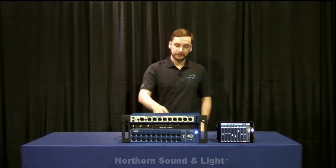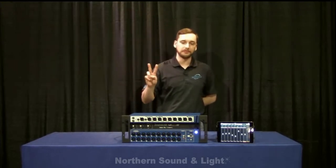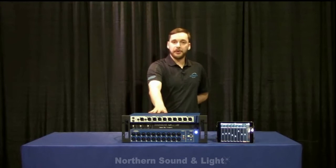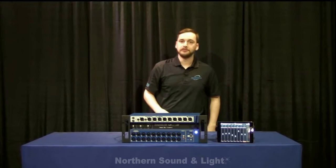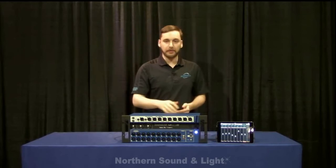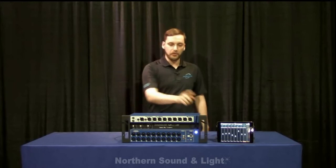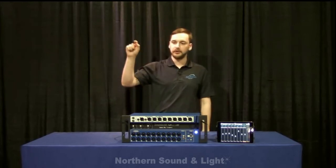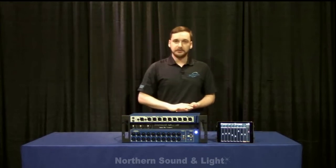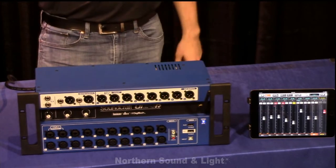There are three different ways you can record. The simplest is to plug a USB stick in the front and record your two-track master output — just hit record and it captures everything going out through your left and right. You can also connect it to your computer, at which point it's a 32-in, 32-out interface — use it with Logic, Reaper, Pro Tools, Cubase, whatever your DAW of choice is. My favorite is using a USB stick to record multi-track audio: pull up the multi-track setting in the interface, select which tracks you want to record, and hit record. It automatically makes a folder and labels your channels with the names you've designated. You can then play them back through the mixer and record that to your two-track master — essentially making this a DAW in a box.